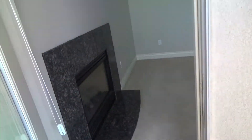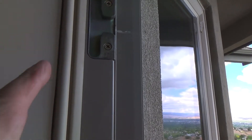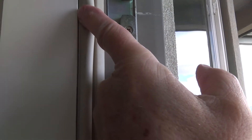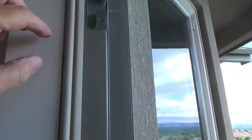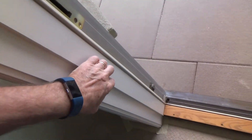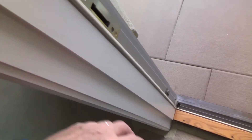With this door swinging out, you've got that thin edge on the outside and the thick edge on the inside. You're going to tell me you can paint perfectly up to that edge by holding it back and putting a piece of masking tape there — assuming the masking tape is going to conform with this rubber and not come off when you paint? And when you saw that other rubber gasket, you saw all the paint all the way down it — that's the same problem here.